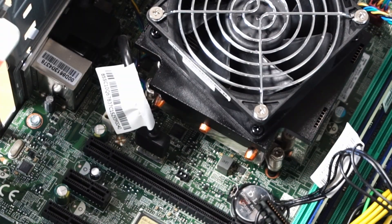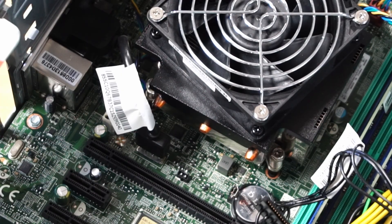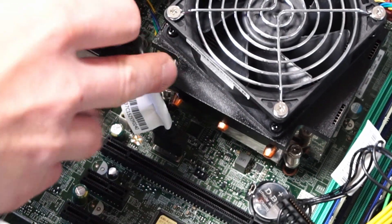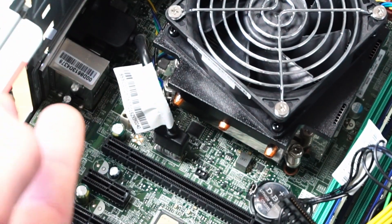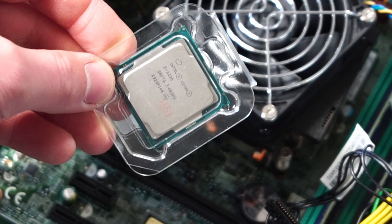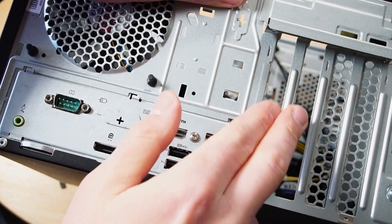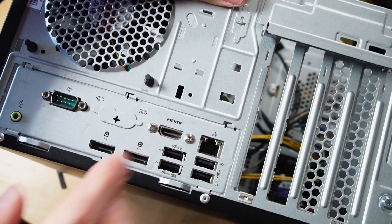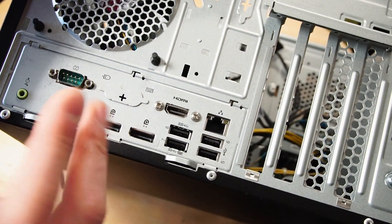I'm pretty much taking the time to cover the basics here — there is actually a lot more to consider, and I'll link to the platform's specifications in a comment below. One thing I'll point out is that we seem to have an HDMI port adapter here connected from the motherboard to the back of the PC case. The Xeon CPU we're installing does actually have UHD Graphics P630, so along with the GPU's DisplayPorts, we'll also have the option of this HDMI port. And that's pretty awesome.